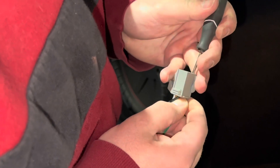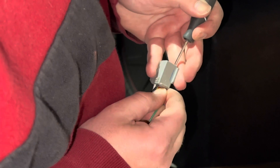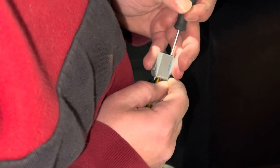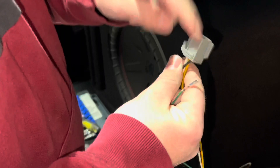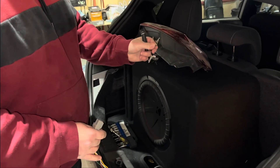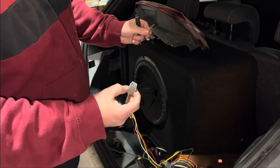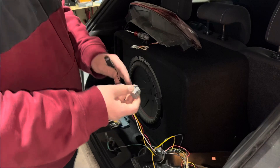So that's how you re-pin it. I just showed you the picture of the wiring diagram, so we're just going to put this back. We're actually going to take this connector all the way off and rewire it to the stock light, which I actually have sitting right here. So you can see all these wires sticking out off my stock light, and we're going to re-pin them back in the way I showed you with the stock headlight on this side — same pattern to finish up the left side. That's how you go from Spec-D back.